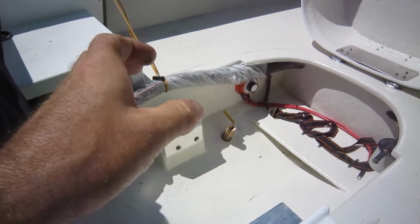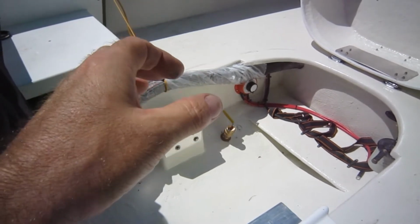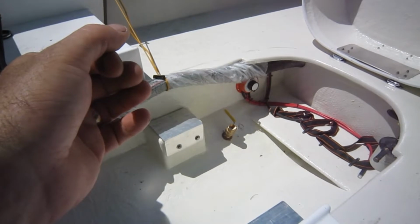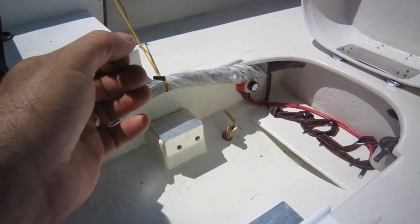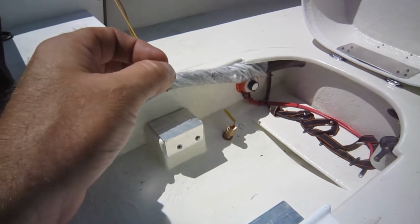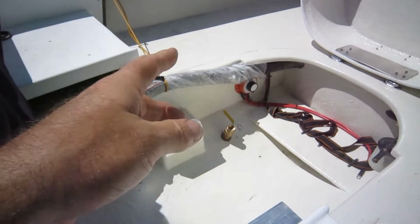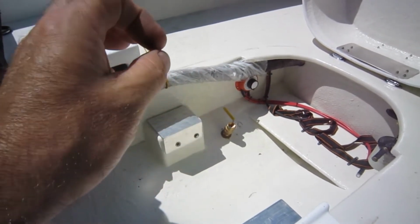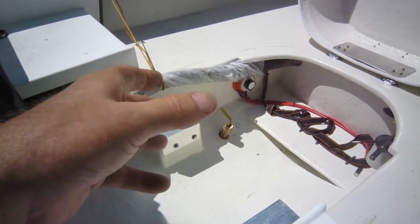Every piece of pipe that I cut, it would not match up the threads. And I'm thinking to myself all night long last night, I'm probably going to have to replace that piece and end up with a 4-inch piece sticking out of there. It took a little finagling, and I'm glad I took the disc sander and sanded it all around and kind of beveled it off up to like 2 threads up, just a little bit.